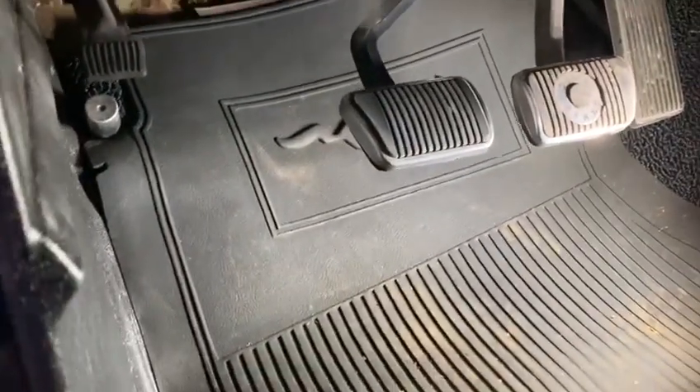Yeah, you're correct — I can't get it in gear; it's bottoming out on that bolt. So it's not a bleed issue. I've looked underneath and there's no leaks anywhere. You've got this big shiny mark on the pedal here, so it's obviously hitting that. It's just a case of trying to adjust it somehow to make this work.